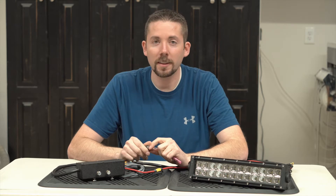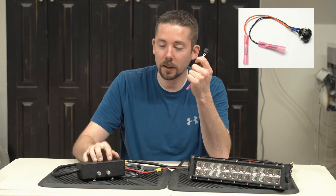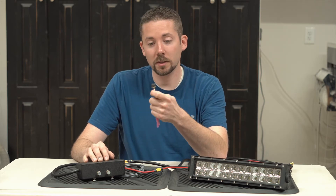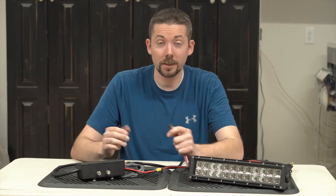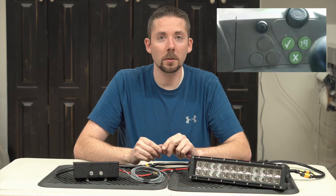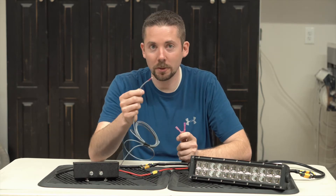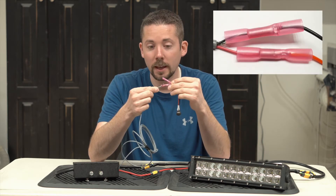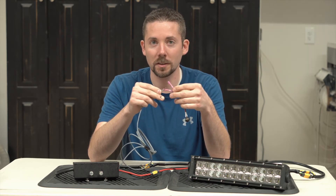As far as the switch is concerned, the kit comes with a waterproof momentary switch, and this is what's going to tell the converter what to do — whether to turn on or off and what modes to be in. This switch is waterproof, so you can use it outside on your ATV, or on your side-by-side, or inside as well. Hooking up the switch is also really easy. All you need to do is drill the hole and mount the switch wherever you want it. Then you're going to run the thin cable to it, put the wire in the end of the butt connector, crimp it, and these are heat shrink butt connectors so you can heat shrink the ends to give a little bit more strain relief and moisture resistance.